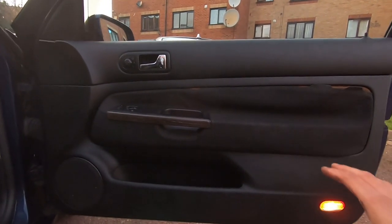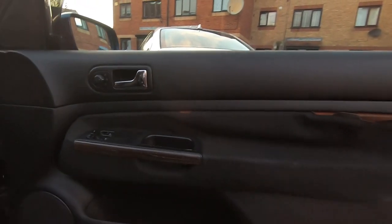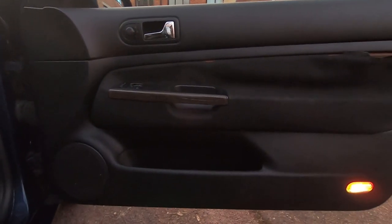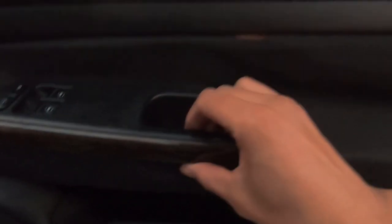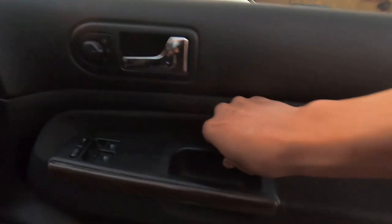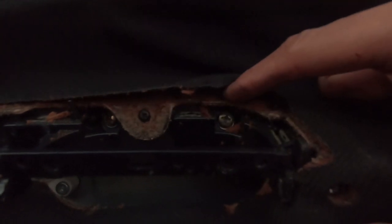It's getting a little bit dark now but I'm going to start stripping the driver's side until I can't work anymore. I also want to make a repair to this door card while I'm working on it. I've done my three Torx screws at the bottom. Now turning our attention to the handle - you can feel a bit of a lip from underneath; you need to push to remove the inner part of the handle. Once that's removed, this here should become a lot easier to pop out. Once we've popped that up, we're going to disconnect the switch underneath - two or three Phillips screws. Then I'll remove the one up in the corner like the other side, and then start pulling the door card off.